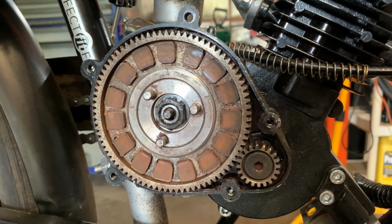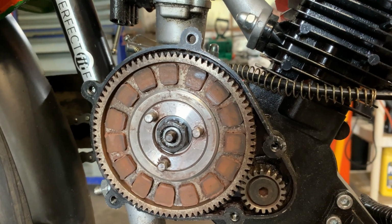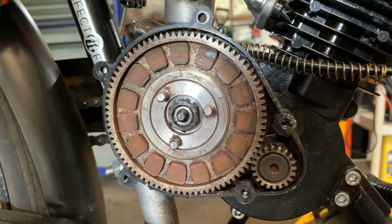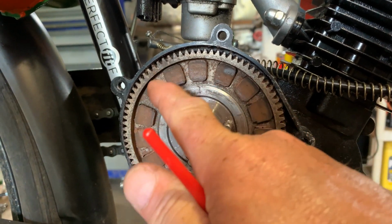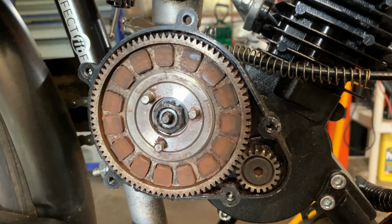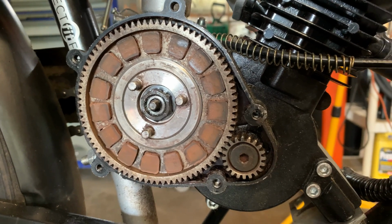It's not an oil clutch system like in a motorcycle, where the clutch system is in its bath of oil all the time, and it doesn't mind it being oily. These mind being oily. If you get a bunch of grease and oil on these, the clutches slip all the time and don't move you down the road properly, and it just gets worse from there.